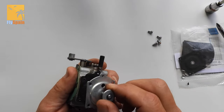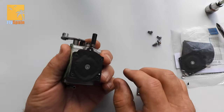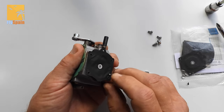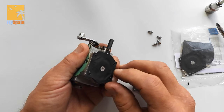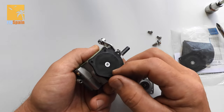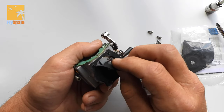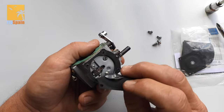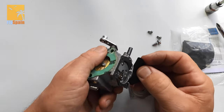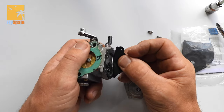We've got this top plate that comes off. You can see there are some lugs there, so you can only fit it one way when it goes back — don't be too concerned. Now try and remember that we're lifting off this diaphragm with a gasket underneath it, and which way up it went. We know that the diaphragm is sitting on top of the gasket. As we pull the diaphragm up, you'll see there's a tiny little retaining clip on there that fits onto that little bird's mouth. When we're putting that back together, you'll have to slide that on there very carefully and make sure it's caught on there.